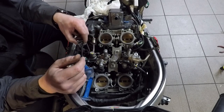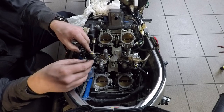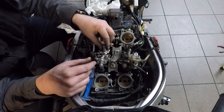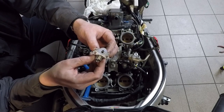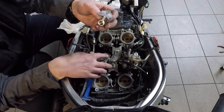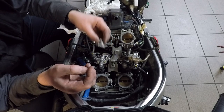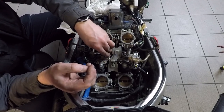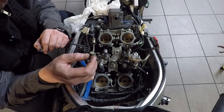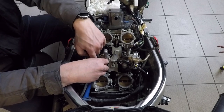They are really, really nice parts. It's a bit old style connectors — you've got to loosen this spring to get the connector out, and you've got to be careful not to lose that spring in the engine bay. Look at this top mount for the injector — it's a very, very light part, so nicely machined. It has double dowel pins to make it center and line up perfectly, with O-ring seal and everything. That mechanical right feeling when you put something down and it just fits just right. So I'm going to keep pulling these off and put the injectors in the flow bench.